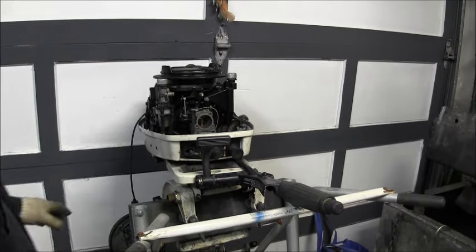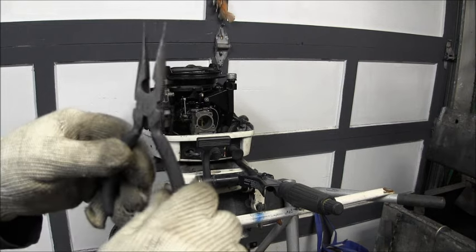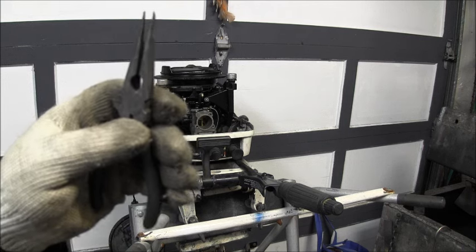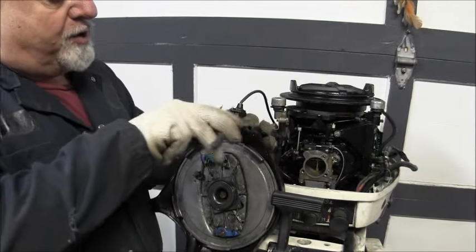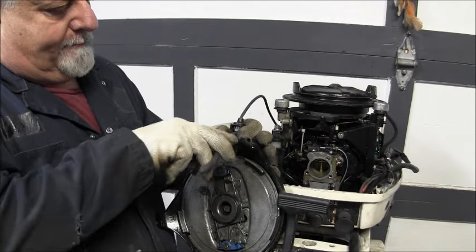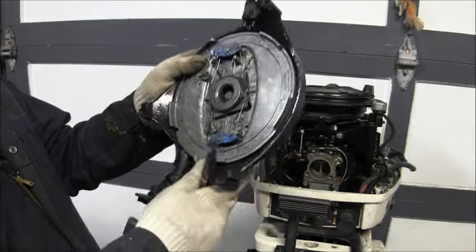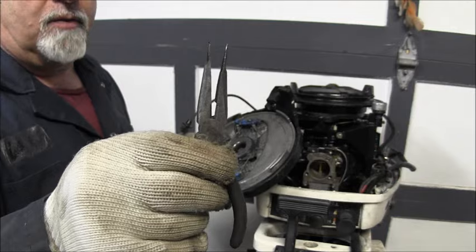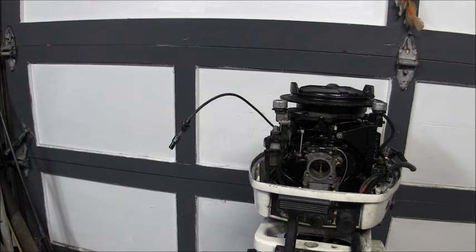Okay, I found my OMC special tool number 03 something. And you go, that don't look like a very special. And it's not. It's a pair of needle nose that I ground down to be real skinny at the tips. And that allows you to get in these recoil things for the safety interlock. They do, by the way, make a special tool for this, but it's essentially this. Special tool number 685230 something. But all you need to do is take an old cheesy pair of pliers, whatever, and grind them off. And pinch it out of there. You gotta pinch it. I pinched it.